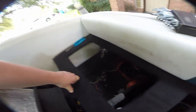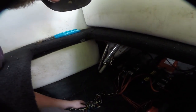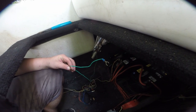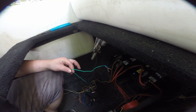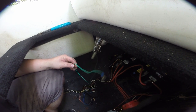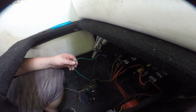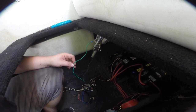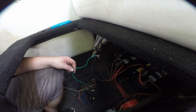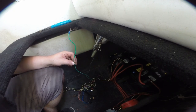Basically what they've done here is they added this green wire — whenever this wire is grounded, the radio is on. It also needs power, but the radio is on. So basically you have a switch and what they were doing is just taking this on and putting it back off. What we're gonna do is make an actual switch that controls the radio and put that on here as well so it's not quite so ghetto.